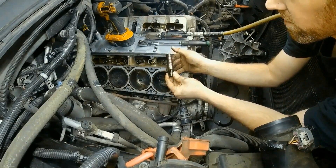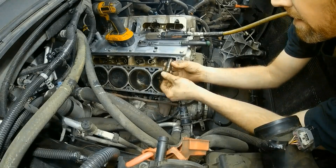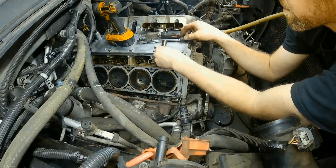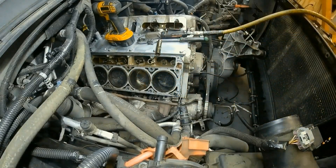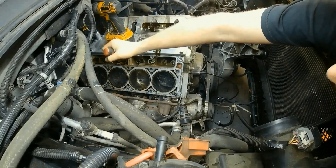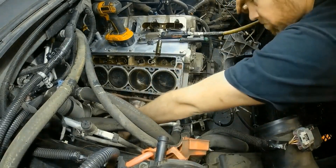Here is a good lifter. This side doesn't have any oil passage; this side does — there is a groove there. And here is the bad and stuck lifter. I don't know what happened there, but it's definitely got an issue. There's the problem — it is literally broken. Here's the part that was stuck. I want you guys to keep in mind how clean these parts are — I'll get to that in a second.